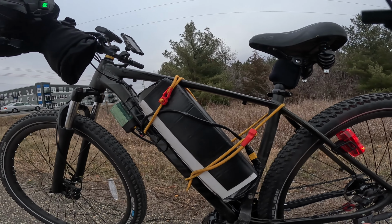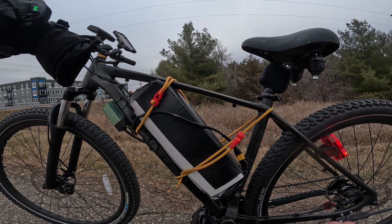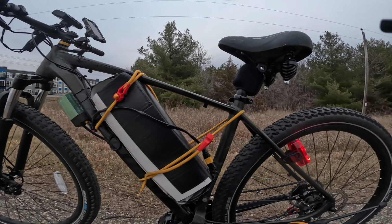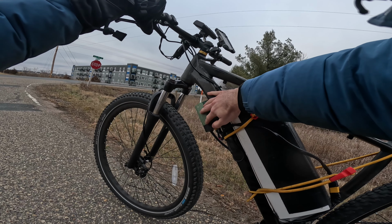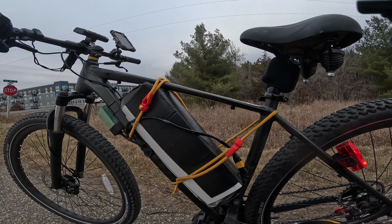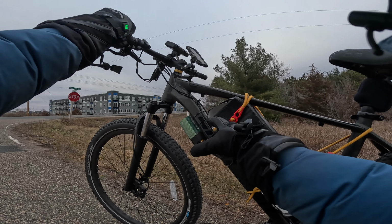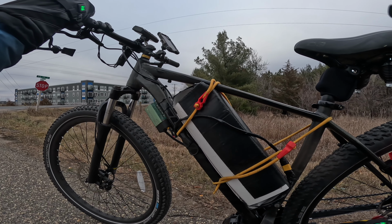And unfortunately, one of the recipes for a high voltage BBSHD build is to increase the field weakening. You might want a little bit more than 25%. So I'm still working through the possibility of working around that limitation in the Phaserunner V6. But for now, I've got my Frankenrunner L10, and I believe this has version 5 of the ASI BAC firmware on it, which doesn't have that 25% field weakening limitation. So, long story short, I put my Frankenrunner L10 on here, and I'm going to use that controller to test out higher field weakening levels, while I work with Grin Tech to try and make it work with the Phaserunner V6.